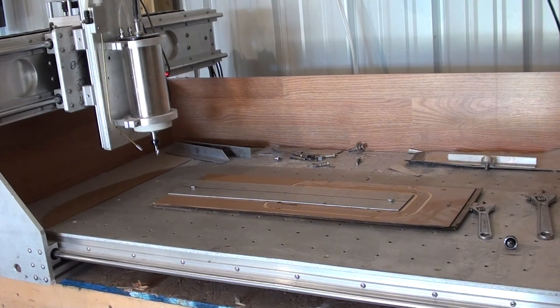I'm going to make this plate out of 1/8 inch plate aluminum. I'm going to be cutting out the pockets so I can set this on the intake and use it for a guide for cleaning up some bad hand porting job that the previous owner had done.